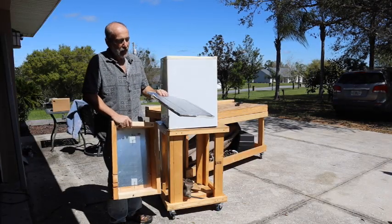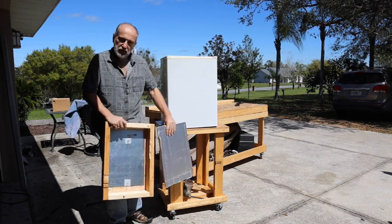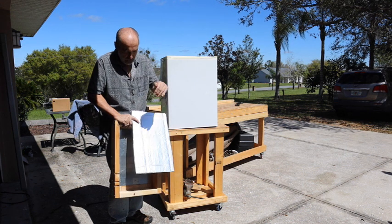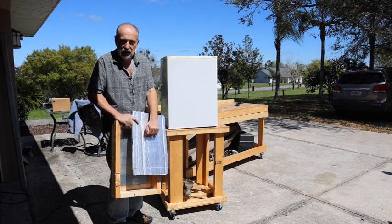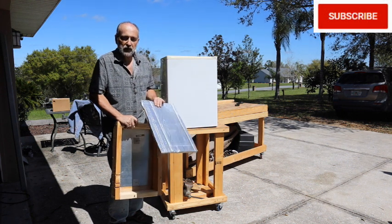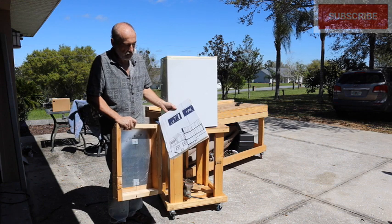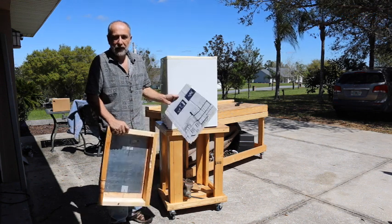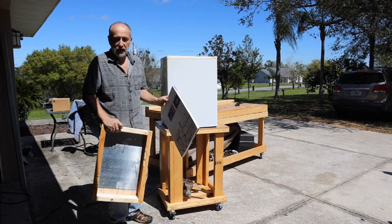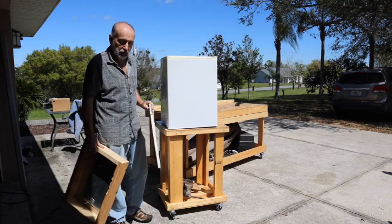What's my objective? I want to find out where the condensation forms — how close does the insulation need to be to the skin of the van so that condensation forms on the outside and not in between the insulation and the van. I'm going to try it with poly iso and XPS and see what the results are. I may get nothing from this experiment, or it might become very valuable.